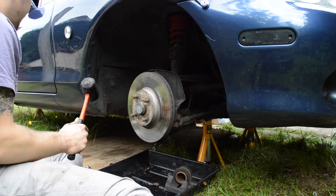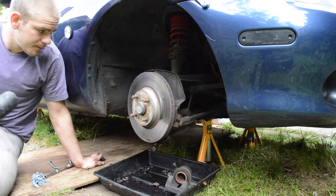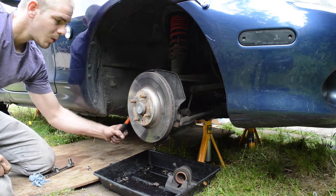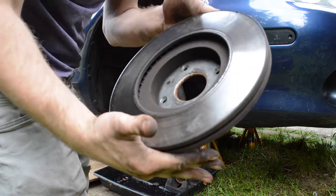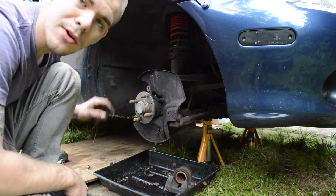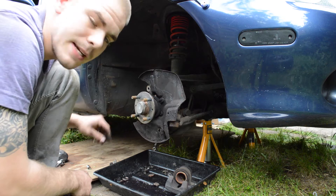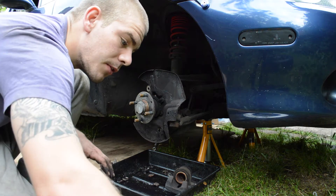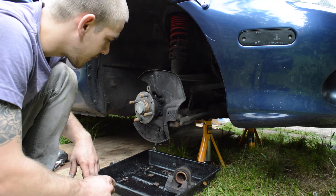On the other side the disc was quite stuck on so you give it a few good taps. Need to get some good leverage on this. So much space when you have a ramp to work on. There's your disc. A little pro tip - if you clean these up and put a bit of copper grease on them when you put it back together, because what can happen is it won't sit flush and that's when you start getting scraping on the edge. Clean those up and then you have a nice non-flappy disc.